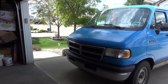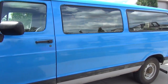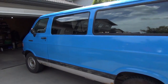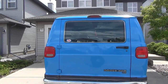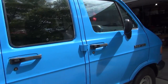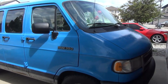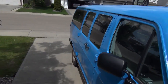Some things I would have changed if I were to do it again: I wouldn't have gone so extreme on removing the paint — it added little divots in the van side. I would have just given it a simple sanding buff, nothing too extreme. I only did three layers of paint because that's all I had time to do, but I was recommended to do between 8 and 10. Around 3 it started to look pretty good, but from my experience I'd say five to six would have made it really sleek and nice. You can always give it a nice buff after. This is how it turned out doing it the way I did — really half-assed because I was in a hurry — but I think it looks a ton better than the original.